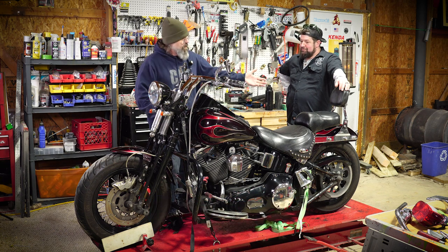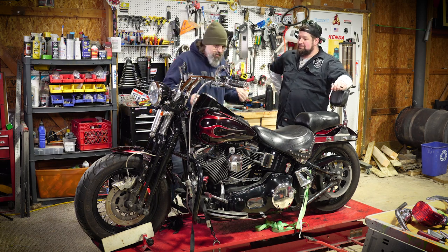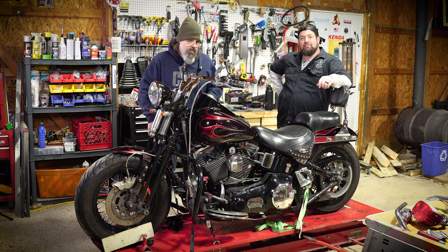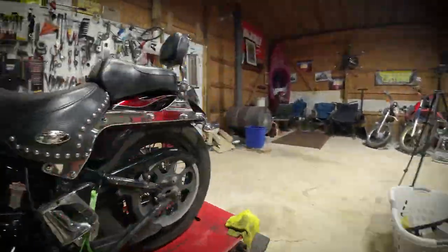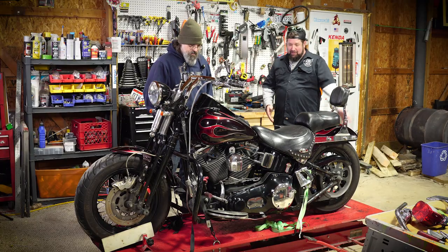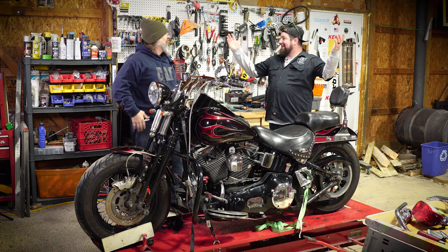There are some obvious things, like I have to do the tail light — that's something I can handle myself. But there's a lot of other things new to me that we can go over. It's a great looking bike. These are kind of like a modern vintage bike. You had the Springer on the front end, but you still had the soft tail suspension, the twin cam engines — great highway motor. They love to be wrung out. You don't have to short shift them or lug them. Matter of fact, it's better if you don't. It's fuel injected, you've got modern brakes front and rear.